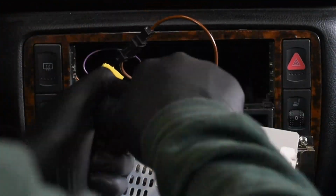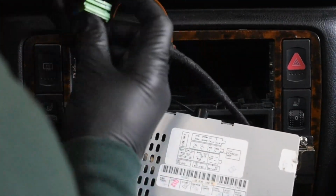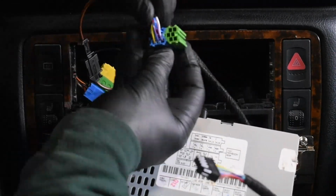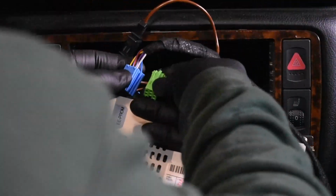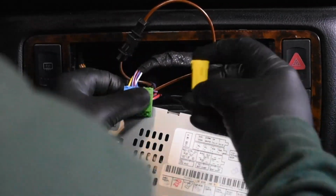Depending on the old connector block setup, the new block will need to be disassembled to include the other wires in the old green and yellow connectors. There are small tabs that hold each section together. We want the new blue section with the old green section and either empty yellow section.